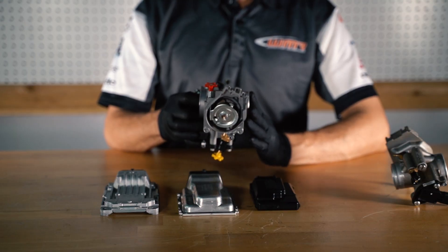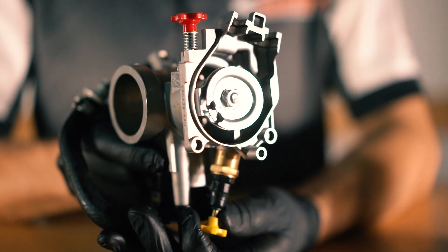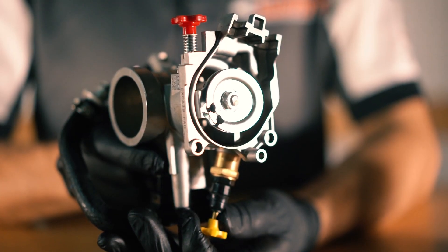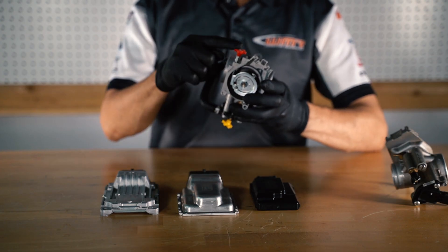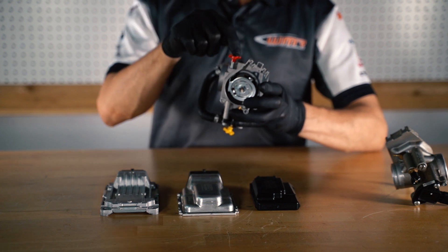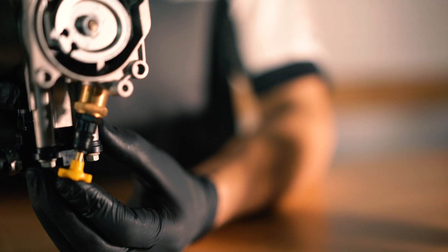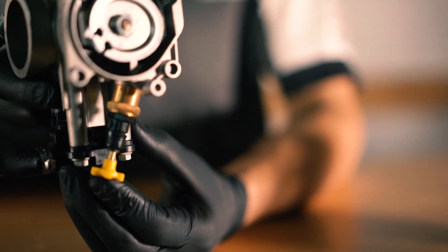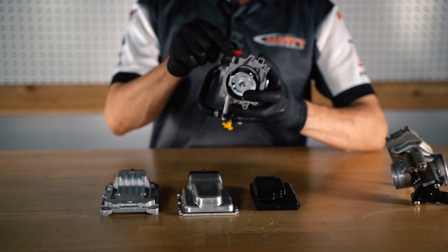This TBI system has two knobs — these will be your identifying features. Your red knob is your idle screw. Your yellow knob is your fast idle screw or starter enricher valve. Your red knob turns clockwise and counterclockwise to adjust the idle. Your yellow knob turns clockwise or counterclockwise to adjust how much fast idle your motorcycle gets when this is activated.